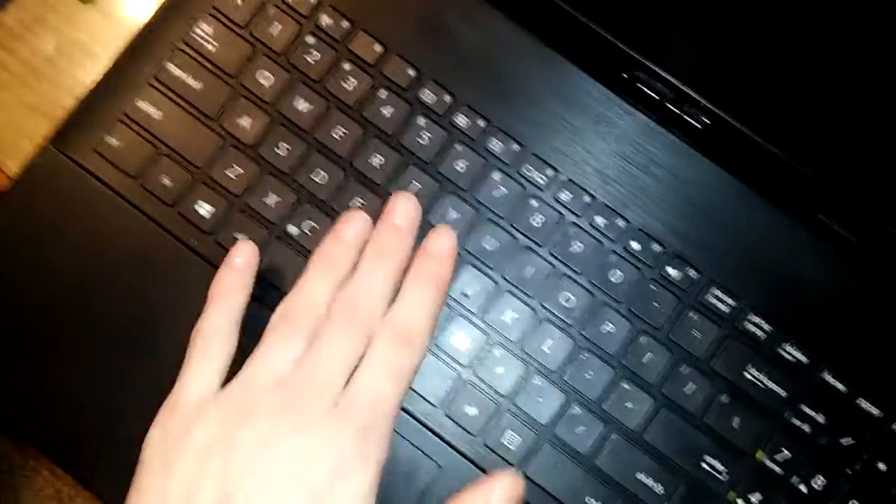Also, you want to watch out because there are ribbon cables — there's only three. They're by the mouse pad, the keyboard, and then the power button, so basically right here, here, and here. If it does take some force to get some of the clips out, that's normal. But if it's not coming out for nothing, that means you probably forgot a screw, so double-check on your screws.